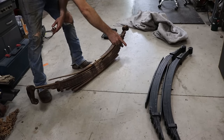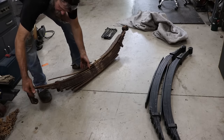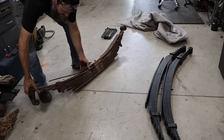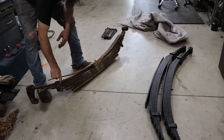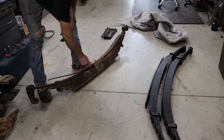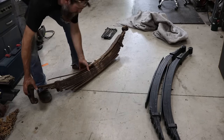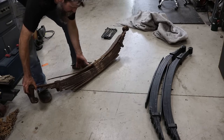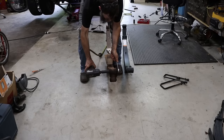So obviously there are our new leaf springs - here's the one I just pulled off. Check this out - this is where it was hooked to the back of the chassis. The only thing holding this leaf even in place is this saddle or strap. Now if this front would have broke, it could have shifted. This could have spit out.